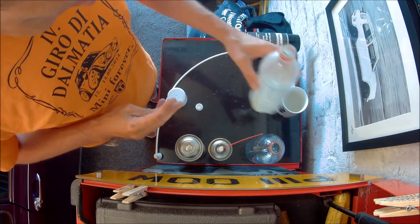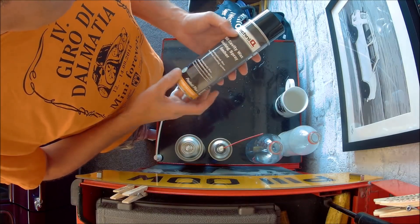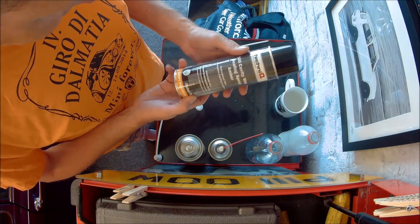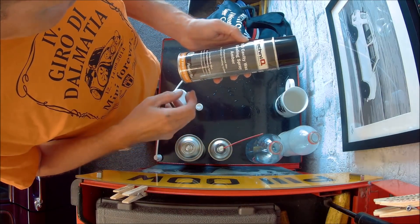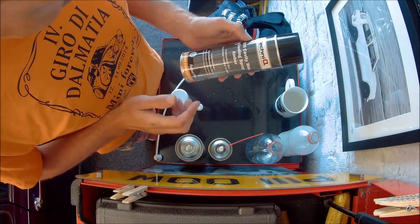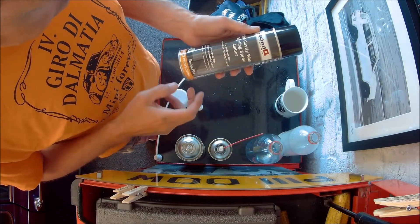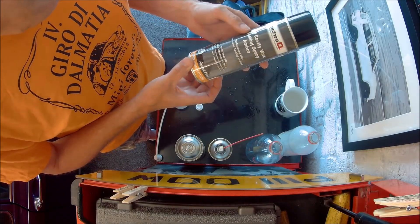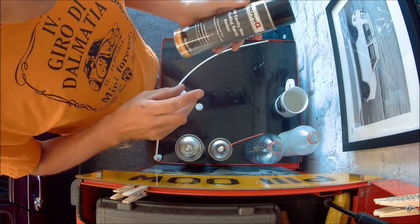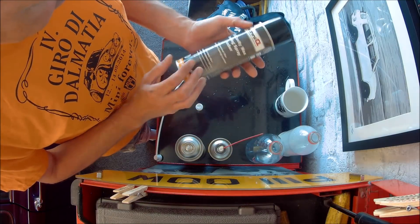What we have here is some specific cavity wax. I just bought this stuff off eBay — it was relatively inexpensive, pound for pound probably as cheap or cheaper than the wax oil. But it's actually made specifically for applying inside cavities. I've used it a little bit on the outside of Vinny, just inside the rear door bins, and it gives a nice coating. It's really thin — it goes on like spray paint with the normal nozzle. You have to apply two or three coats to get a thick coating, but what's very good about it is it's thin enough to fit within flanges or overlap gaps.